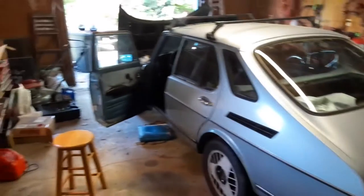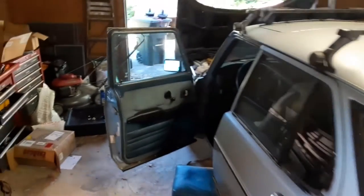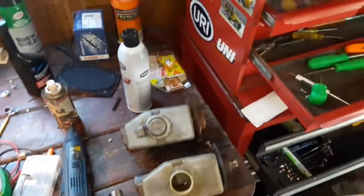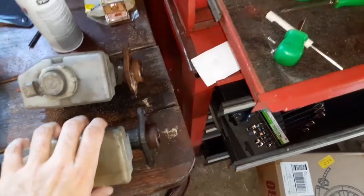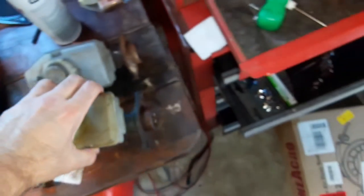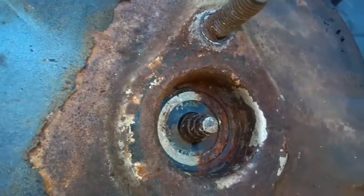The Saab has got a problem — not surprisingly. There are issues with a brake master cylinder. I was trying to move the car a couple of weeks ago and the brake pedal decided to go straight to the floor. That is unfortunately a leak out of the back of the master cylinder, and the booster does not look great either — just a lot of rust and flaky material.